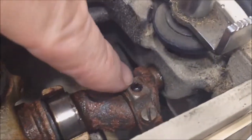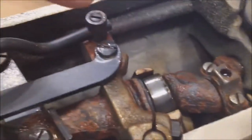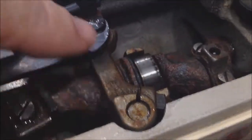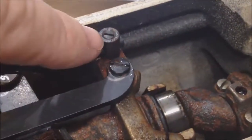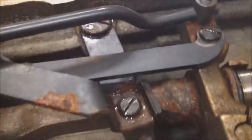For this connecting rod here, you need to oil and clean the cam that's here. You need to oil any part that moves up here, which includes this pivoting part, this pivoting part, that pivoting part. Coming over here, you need to lubricate this one and this one as they do technically move. You need to lubricate that because it moves. You need to lubricate this sled because if you change your width, it moves too.